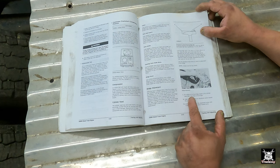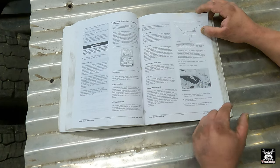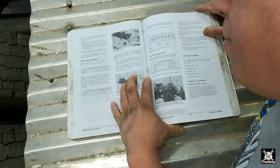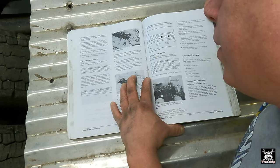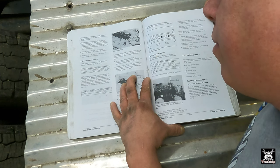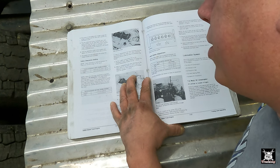Put engine oil on the bridge dowel in the cylinder head and in the bore of the bridge. Install the bridge with the adjustment screw toward the exhaust manifold. Loosen the lock nut for the adjustment screw and loosen the adjustment screw several turns. Put a force on the bridge with a finger to keep the bridge in contact with the valve stem opposite the adjustment screw. Turn the adjustment screw clockwise until it just makes contact with the valve stem. Then turn the adjustment screw 30 degrees more in a clockwise direction to make the bridge straight on the dowel and to make compensation for the clearance in the threads of the adjustment screw.